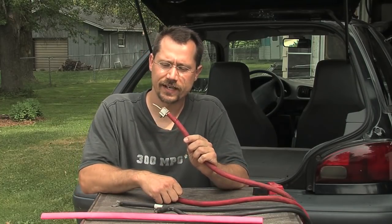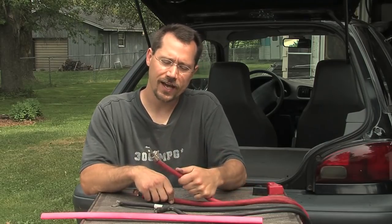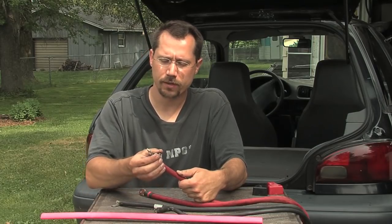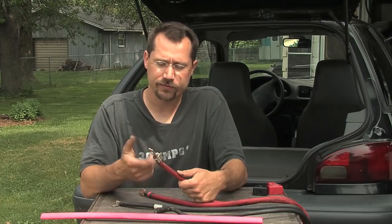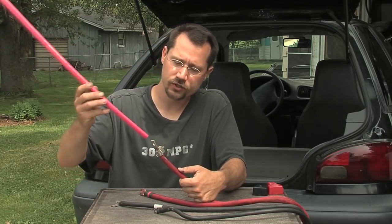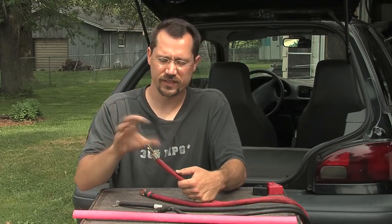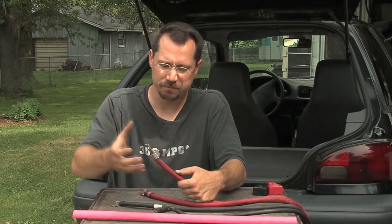This is a different style of connector. This one simply slides on and then you tighten it down with a set screw. This is not my favorite type of connector — it's real bulky and it's hard to get quite exactly the way you want it on a battery. But a friend of mine had a big box of these, so it was a good way for me to cut down on costs. However, the shrink tube will not make it over there, which means you have to use some sort of specialty battery cover or electrical tape. It's really not the best way to go.